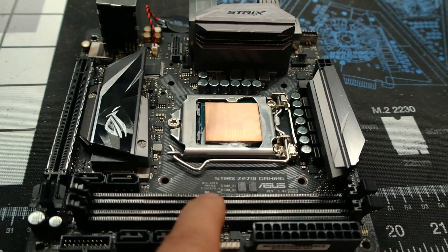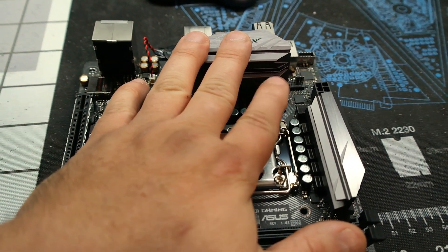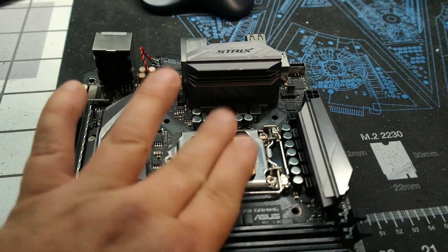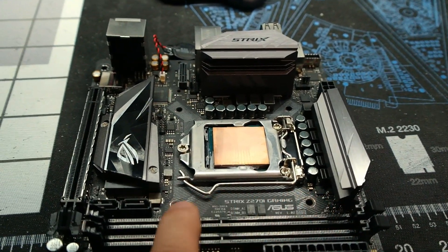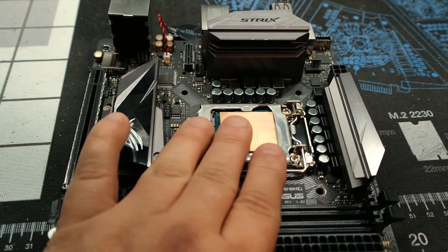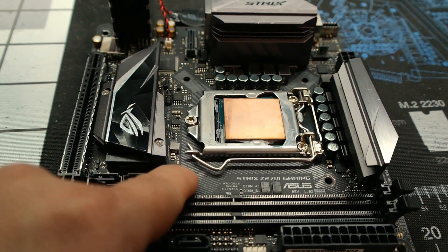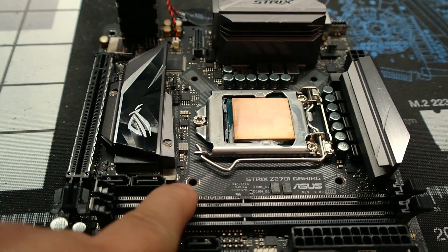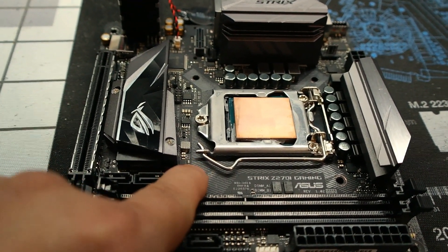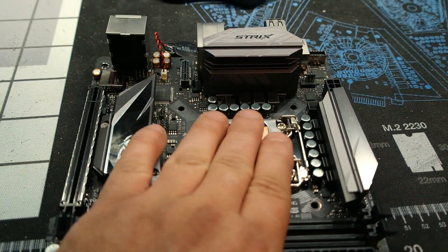The RAM still works. So that leads me to believe — the RAM was in here and is still good. This unit still pulls 35 watts when you try to power it on, but it doesn't do anything. I believe the CPU is still good. I think we're just having issues here. So I'm going to attempt to repair this, but my hopes are not very high. We're going to try to sand away very gently the solder mask in this area to expose more of the copper traces, then lay a little bit of solder on it and repair it.